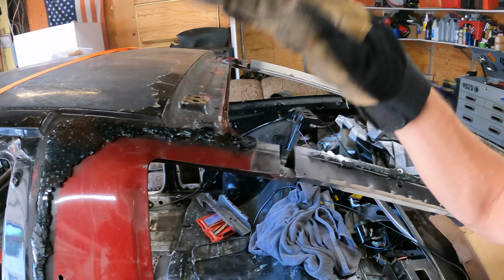Well, since there's not coilovers on this car, I'm just putting a bolt and a nut on the strut brace. All of the nuts and bolts are attached onto the car and the jig very loosely. So I just need to put on this bolt right here and the bolt for that side. And I can't put those on yet because it doesn't exactly line up, which tells me I need to raise the roof a little bit.